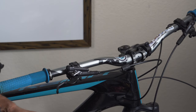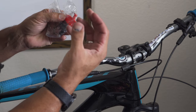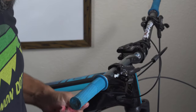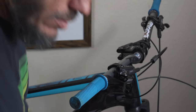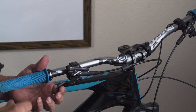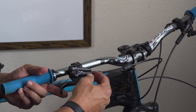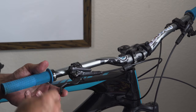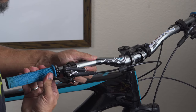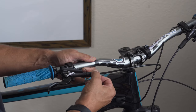Before you start squeezing that brake lever, one thing I want to tell you is — from the little parts kit — this little red insert, you want to put that between your rear brake pads. That way it's not squeezing the brake pads too tight, and when you go to install your wheel with the rotor, that space is still left in there. We can take out this little white piece that just pulls right out, and now our brake lever will work. So now that we have that red insert in our rear brake caliper, we can squeeze the brake a couple of times. We are going to have to bleed this because as we put that cable into the housing there's going to be a little bit of air inside the reservoir.